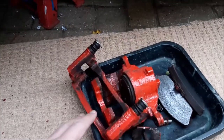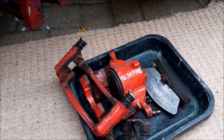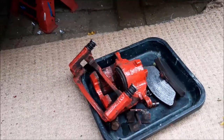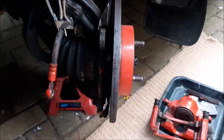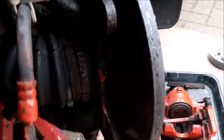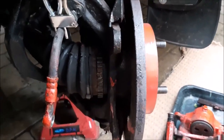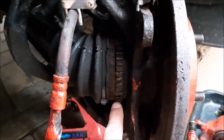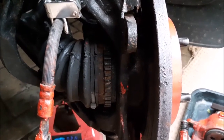Now that's all away, we can start to clean things up. What we do is buy a piston kit rather than changing the whole caliper — the kit gives you the piston and rubber seal. We also buy the sliding bolts as a separate little kit. We'll show you all that going in, as well as removing it and cleaning it up. I just want to show you around the back here — you can see the two mounting points where we undid those bolts to remove the carrier. You can also see the ABS ring in there, which is like a load of teeth, and there's a sensor sensing the pulses as the teeth go around.